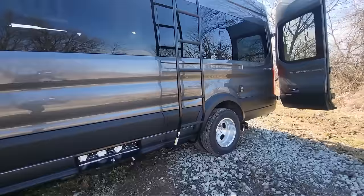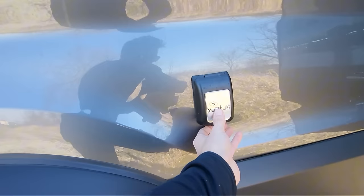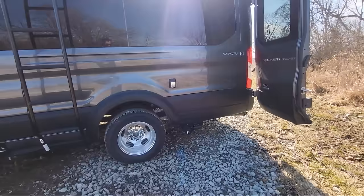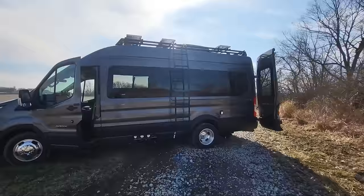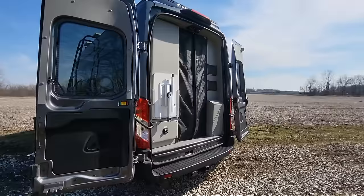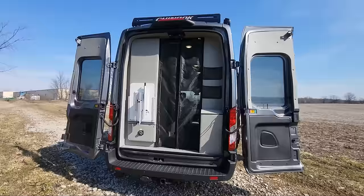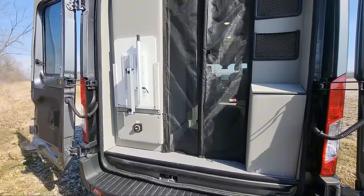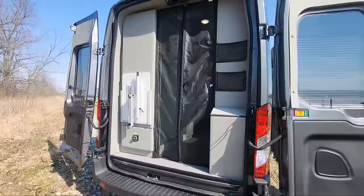You're only going to see that cut there and then a cut for the smart plug. The smart plug is nice because it's a 30-amp cord that plugs in one way and has a little light indicator to let you know you have clean power. There's your dump station. Your tanks: you've got a 30-gallon fresh tank, 24-gallon gray tank, and 10-gallon black tank. Back here the doors open wide open. You can see the screen back here, a couple nets, a storage box for your shore cord, and there's your Laguna table with a holder back here for it.